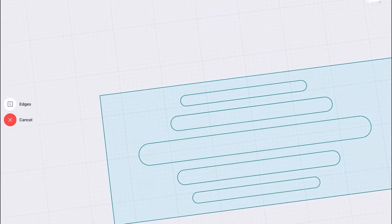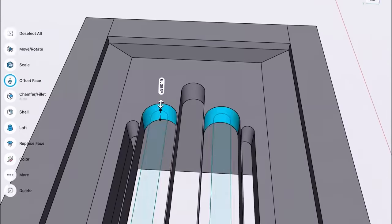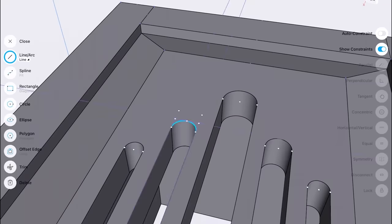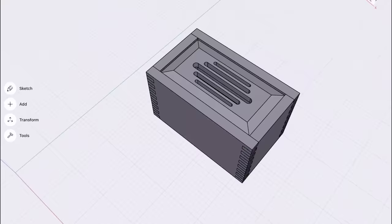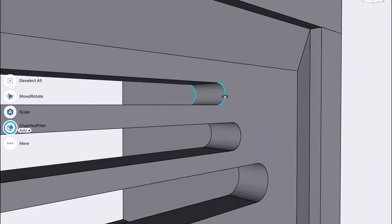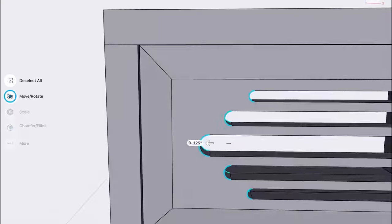Here I'm modifying the face to accommodate larger speakers placed further apart on the baffle board. Since the enclosure is getting scaled up, I need the face part to be bigger and I need to extend the slots so that it doesn't cover up the speakers but still fits within that 30 degree bevel.